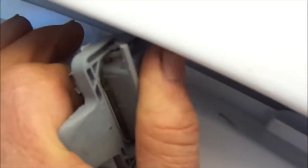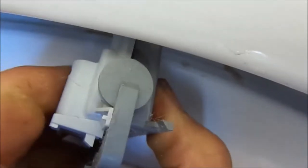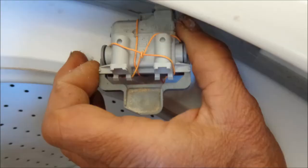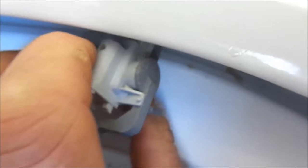I've got a little goop and some copper wire — you can use a vegetable tie too. I pulled it out a little bit so you can see what we're doing. The light gray half and the dark gray half need to be glued right in the middle there. You can't glue where the swing arm goes or you'll bind it, so the glue goes right in the middle, on the back side and this side, then wrap the wire around the two sides and that'll save the switch.